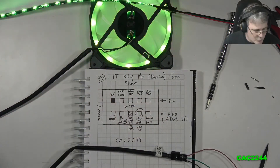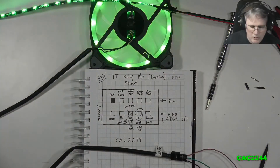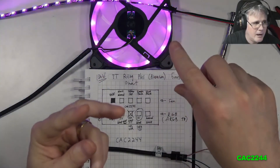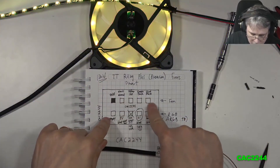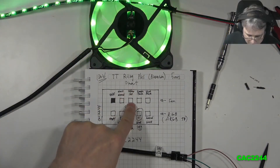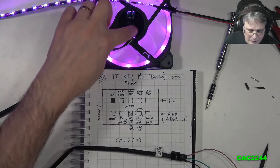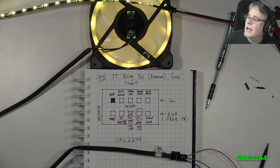You can actually remove the pins and make your own PWM fan header — solder it and send it to a motherboard fan header, a fan controller, or a Y-splitter. For example, I want the AIO pump fan going to the CPU fan header, the rear fan to Chassis 2, and the front fan to Chassis 1, so I can control them separately in software. The top row pinout: the solid pin is blocked/unused; next is ground (black cable); then 12V (yellow cable); then tachometer (green cable); and finally PWM — pulse-width modulation — (blue cable). I know this because the PCB labels it with a 'P'.